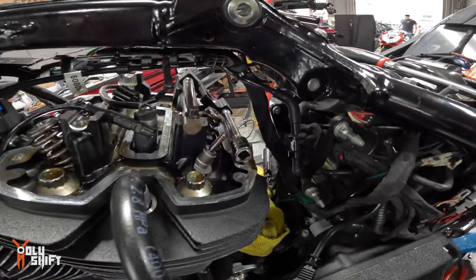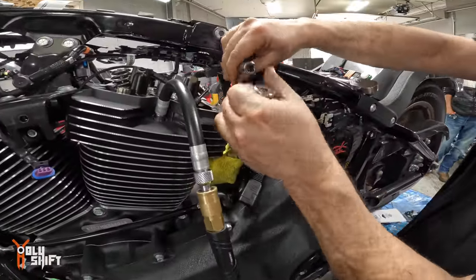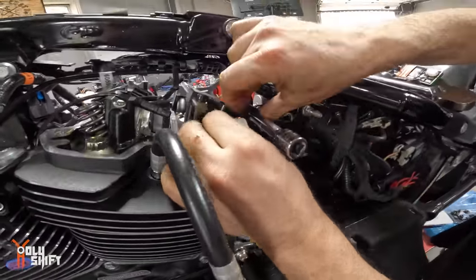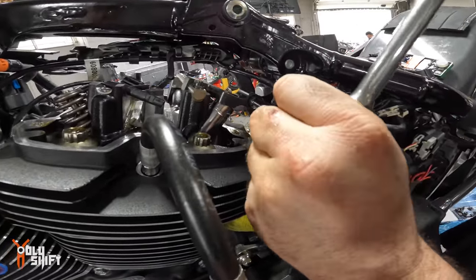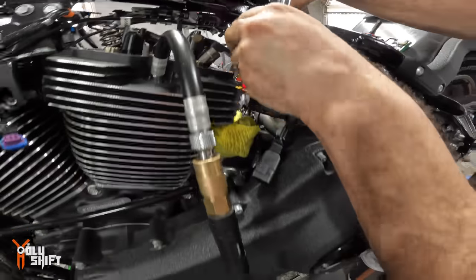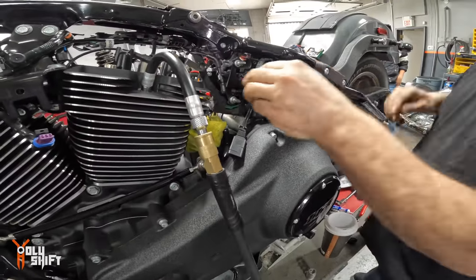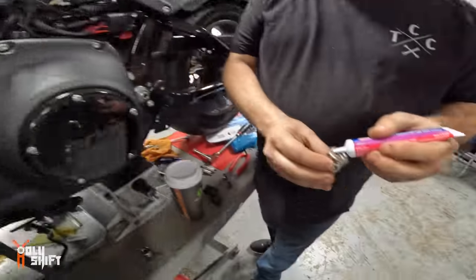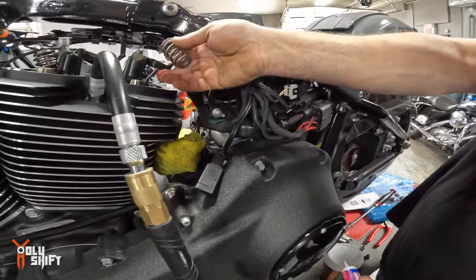Okay. There you go. They stay up a little bit, so I use a 3/4 semi-deep socket, and not a lot of pressure, just a little, just to seat the seal. You'll watch it go down right there. That's it. You don't have to do that, but it makes it easier to put the spring in. So there's your new seal. Assembly lube on the bottom of the spring. People can use oil. I use assembly lube.